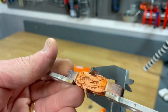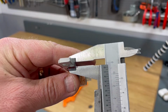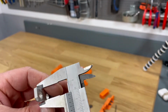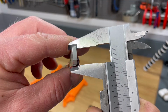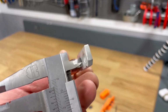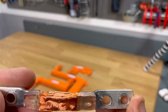And this is really compact, so I'm pressing it. And we have 4 millimeters thickness of this metal piece that you screw into the battery module, and it is also 14 millimeters wide, almost. And the bolts that will connect those to the modules are M6, 6 millimeters, and you will have 2 bolts to each connector to each module. So really heavy duty there.